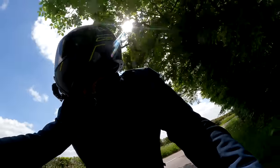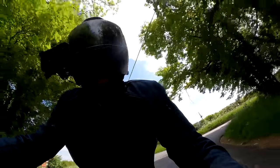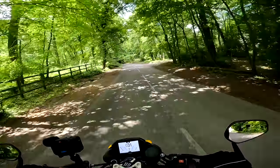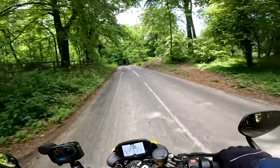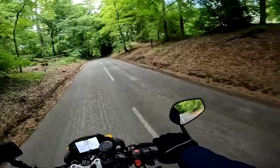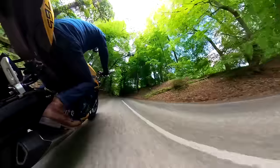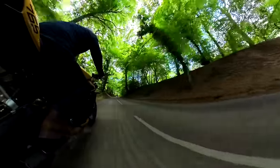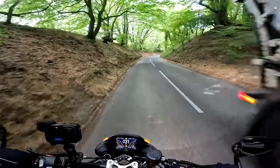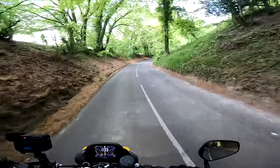Let's come down this way. Let's just quickly test the brakes, nothing behind me. Slightly uprated brakes on this as well. This has got the Brembo Stylema on, whereas the R, its less blingy little brother, has the M4.32 calipers. Let's just try that. Holy cow, those Stylemas are really good. Really progressive feel, great initial bite, and then prodigious stopping power.